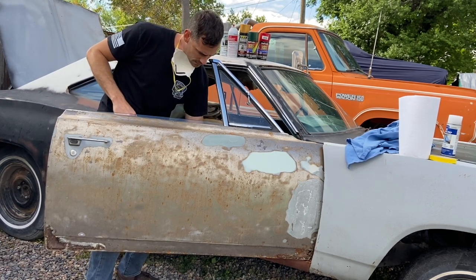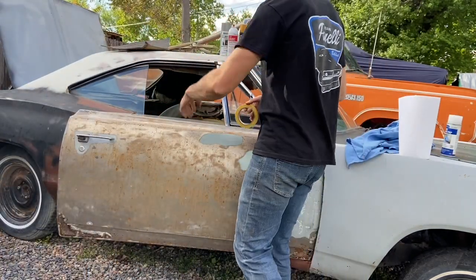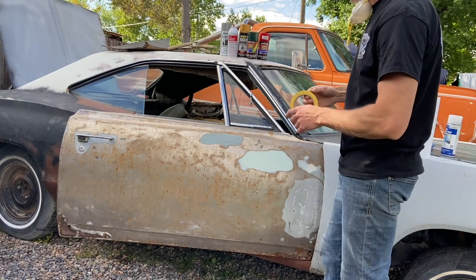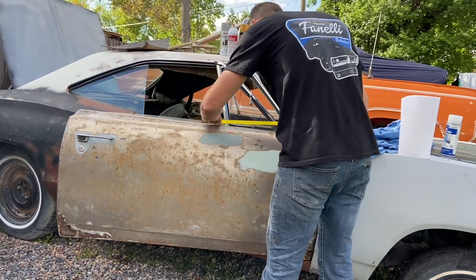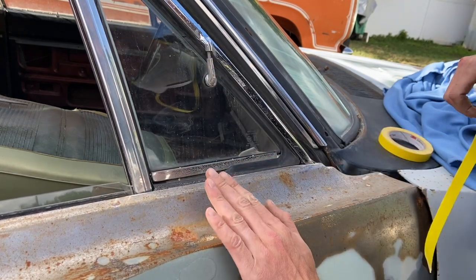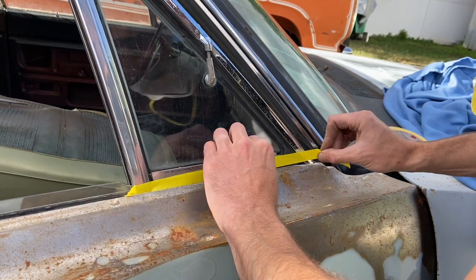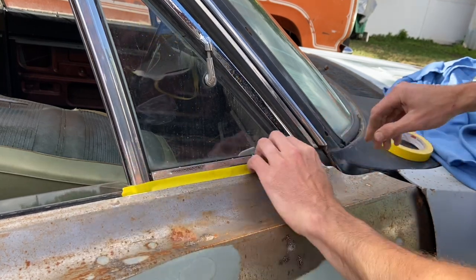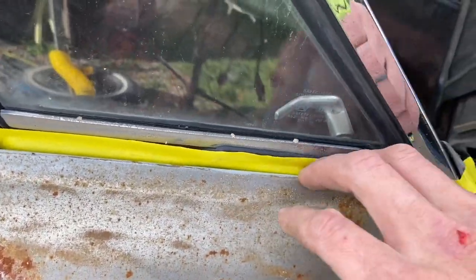Window actually tracks pretty good still — cool. Let's do a quick mask job. We'll mask off this door handle, lock, top part of this window, and this A-frame window here as well. The glass is what we care about; the rest of it if it gets overspray, oh well. When masking, we don't want to get paint on any of this rubber or the metal above. The tape gets tucked just underneath the edge so paint can roll over the metal but won't get underneath and overspray onto the rubber at the window.